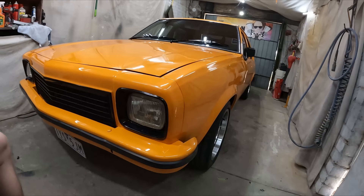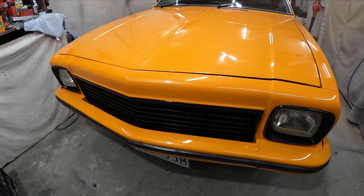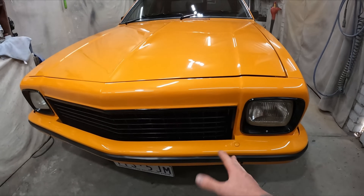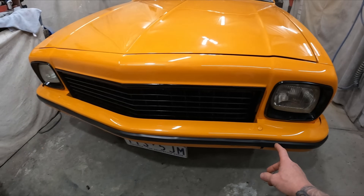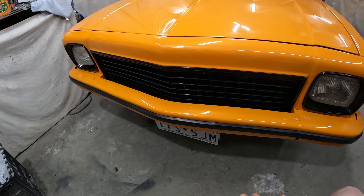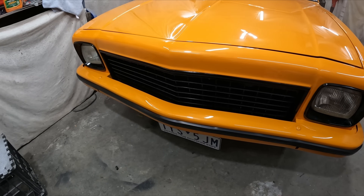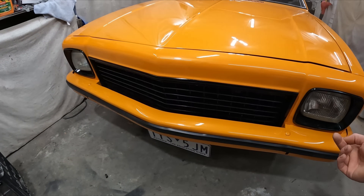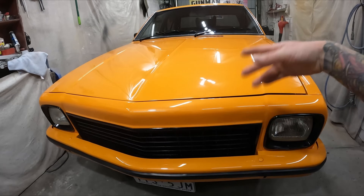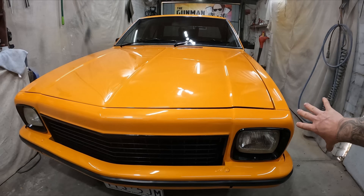Obviously from factory they're not painted bumpers, but I reckon it looks really cool with the painted bumpers, and it just worked for this job. The car did start to cost towards the end — like $35,000 when I stopped counting, so it could be up to $40,000 or something. There were highs and lows — rust and dents all through these bumpers. I was able to bang them out, fill them up and throw a bit of paint on them. To have them re-chromed you're looking at minimum $800 up to around $1,500, and they would have had to be in good condition to chrome them anyway. This car has had more hits than Elvis — hit front, back, rear, side, everywhere, including the bumpers.